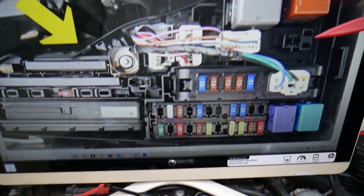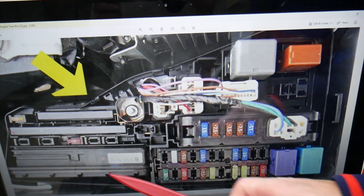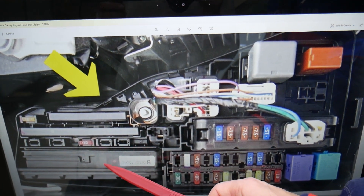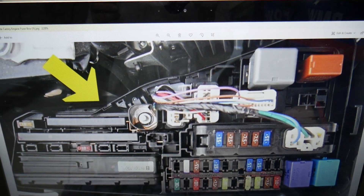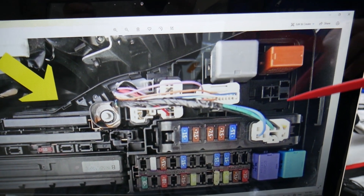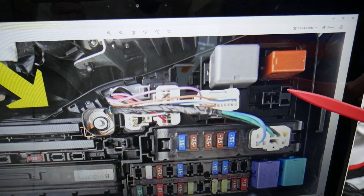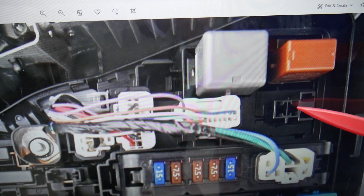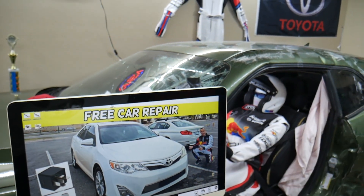Altogether, you have only five relays on that car. If you wonder where the other ones are, most likely they're part of the integration relay — hopefully it never goes bad because it's expensive. We'll put a link in the description where you can get it at a good price. But if you have an alarm system on your car, the alarm siren relay will be that relay right here, next to the orange one — that orange one is the radiator fan. That will be the alarm siren relay. Hopefully the video was helpful. Thank you for watching — see you next time.